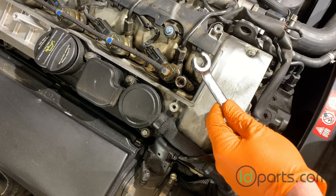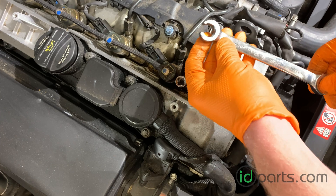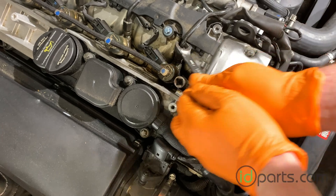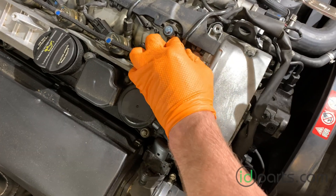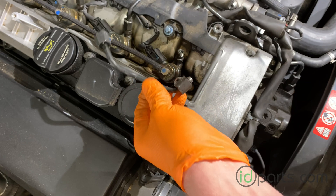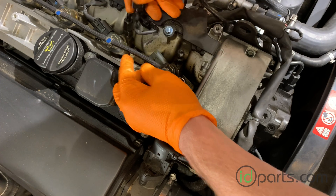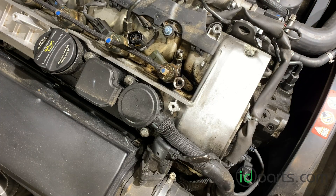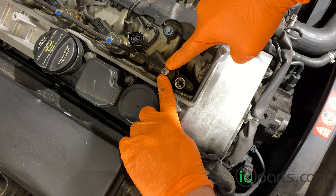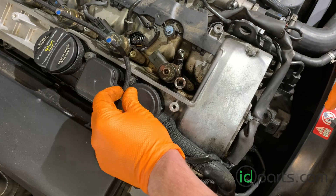The first thing I'm going to do is take off the injector line — it's 14 millimeter on this car. I've got a flare nut wrench here, which grabs basically all but one side of the nut. A little fuel will dribble out, so store the line so no debris gets inside. You can see the black death has reached the connector here too. On this fitting there's an O-ring between the injector and the line that you'll want to replace whenever you remove it.